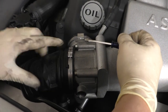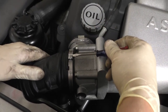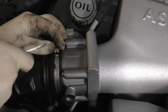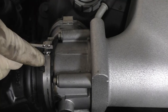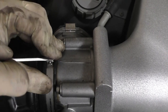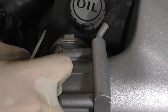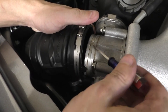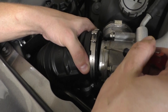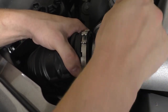In order to get the air duct out of the way, we need to remove this clamp. It's pretty easy — you just need a very tiny flat head screwdriver. Put it in the end here and sort of pop it up like this. You can see there are teeth on here that bite down on the end when we press it back together. So let's go ahead and pop that back off, and now that clamp is loose and we can work this off. It may be easiest to use the flat head screwdriver to pry this out — there's a little ridge that the inlet duct sits in and it can be difficult to unseal, especially with how tight everything is.